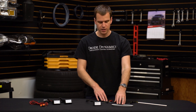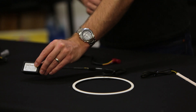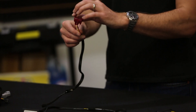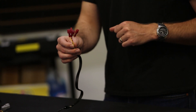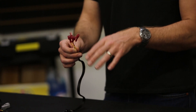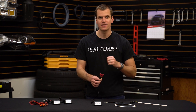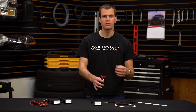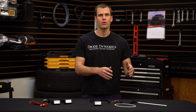With these sorts of products we have the LED itself going to a driver to control the voltage and power levels, and then we have our input signals. Diode Dynamics uses a ground, a turn signal, a high power, and a low power input. The Diode Dynamics products use all four wires on switchback and single color products to offer dimmed functions and extra functionality with every set of lights, whether halo or strip, switchback or single color.